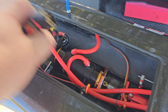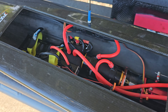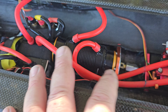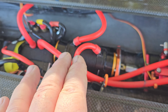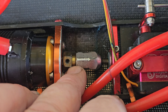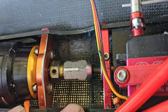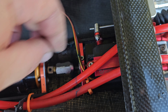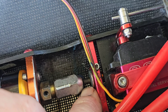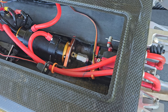I'll go over the boat real quick for those of you new to the channel — if you're new, subscribe and like the videos; it helps the algorithm get my videos out to a larger audience. I'm running the Hydra, a 4070 TP Power CM at 1,400 KV. This motor is actually 12S capable. I removed my coupler protector — this motor has an 8mm shaft so I had to do that. I actually had to cut that coupler protector in half to get it out. Cut the back piece off the retainer, slide it in, cut the forward piece off, bolt it back on, and it's ironclad.